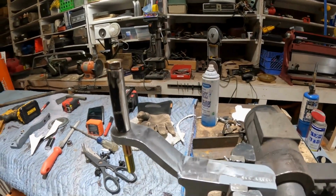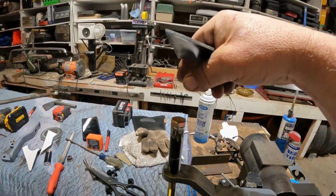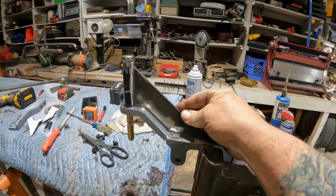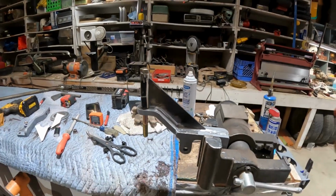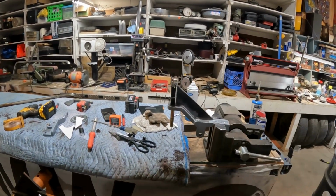Instead of just having a bushing in there, this is just a slug. See what I mean? And the bolt's in there to make sure that it's going through. But anyhow, I am going to build these and put gussets on the bottom of each one so that when I put the drag link on there, it makes it stronger, guys. I'm beefing it up.